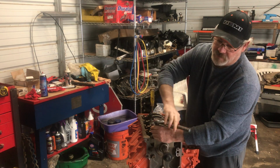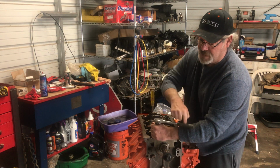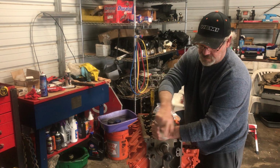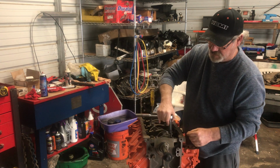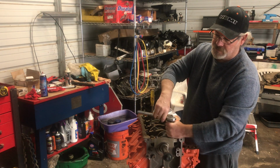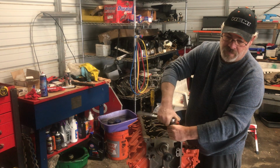You also need to get the valve covers for the Eagle heads, because your standard pre-Eagle valve covers will not fit. When they came out, the Eagle heads' rockers actually sit up more than on the pre-Eagle heads, so they won't bolt down all the way.